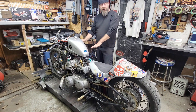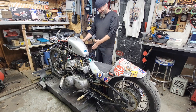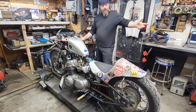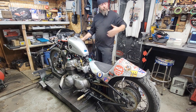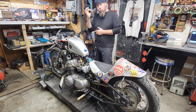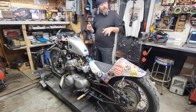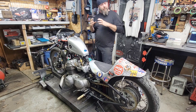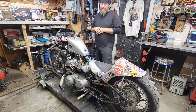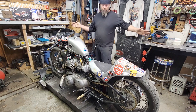This engine is a bit tougher — the top end of this engine is tough as nails. It's RC Engineering pistons and top end. The head was built by RC — it's stamped on the bottom, I'll show you guys when this comes apart. The bottom end isn't — this one is pretty much stock except for my build and tune, my blueprint which I'm double-checking everything, and then my big-ass port head. The ports are huge — throw a tennis ball down. I want to test everything. I really want to use the High Rod F Cam but I almost want to go with a bigger lumpy cam cause I know it will work. I think the F Cam will stay for now just because I want to test it.